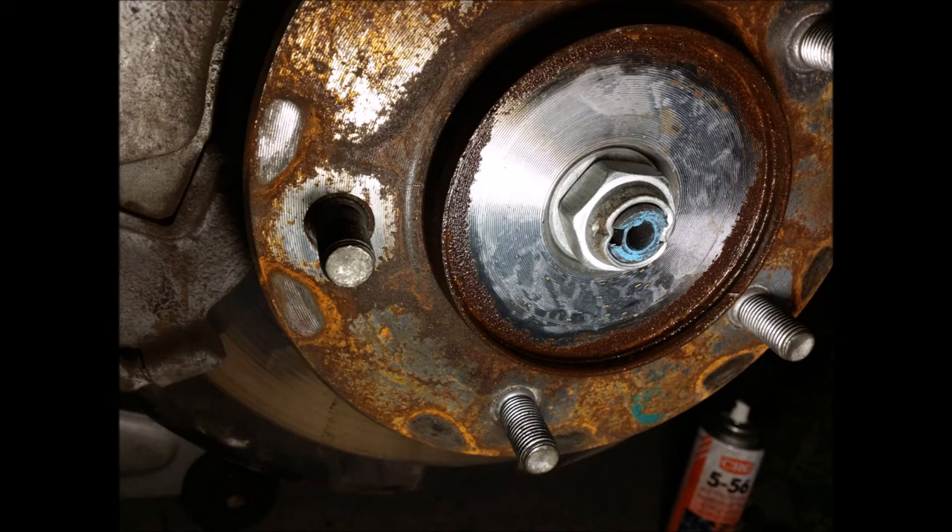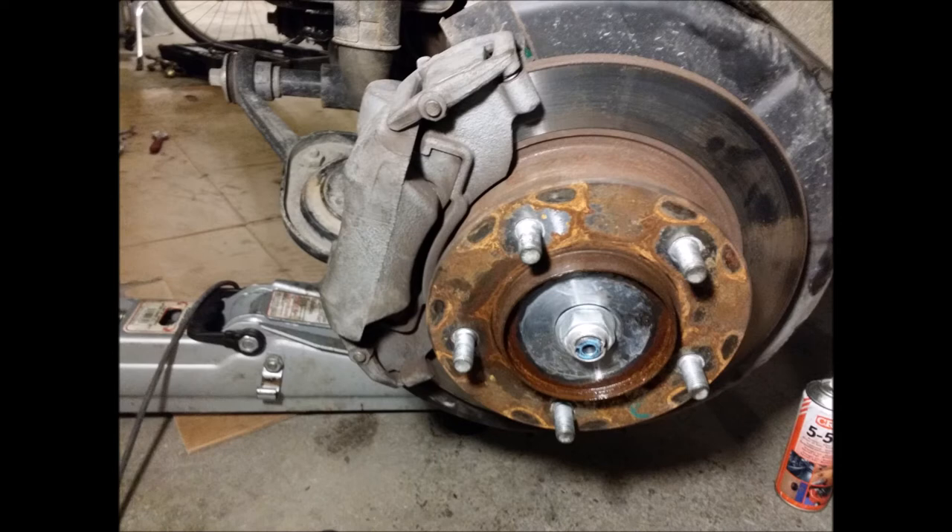You're also going to need some sort of pin to help push out the crimped edges on the axle nut keyway. What they do is use a machine to crimp the axle nut into the keyway, which means if you just use brute force to remove it you probably won't be able to reuse it — that's why you should purchase spare axle nuts. In my case I used an awl and tapped out the keyway a little bit. Keep in mind that whatever tool you use should have a hardness between the axle and the nut — if it's harder than the axle, you'll chip or break it.